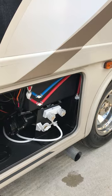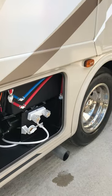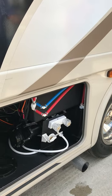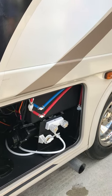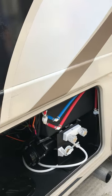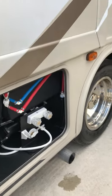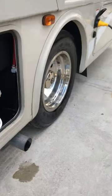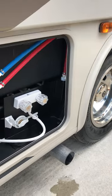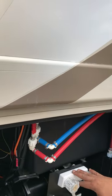I don't understand. Why would they do that? Why wouldn't it connect into that gray water tank? Because it's in a separate area. They need gravity for it. It all has to be gravity fed. In order for it to be back there, it would have to be at a certain pitch. And your sink is up here, so in order for it to run properly, this is just straight down. So this would be the tank then. Yep, and it's empty. Your tanks are above all of them. So your other two tanks will be in there. This is the outside shower.